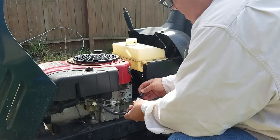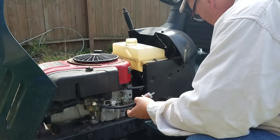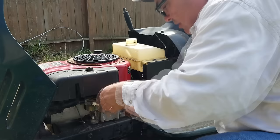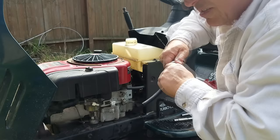We've got the tank-to-filter section taken care of. This fuel filter doesn't necessarily need to be replaced — it's only one season old and it looks pretty good. There's a little bit of dirt in there but I don't have another fuel filter on me at the moment. So again with the pliers, we're going to take this compression clamp off, slide it back. This is a plastic fitting on the side of your carburetor so hold both sides carefully and pull it off. The fuel is flowing pretty good through this one, but we're going to replace it because of these cracks.